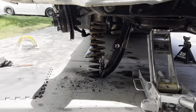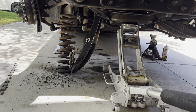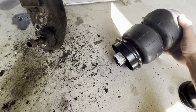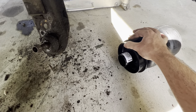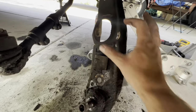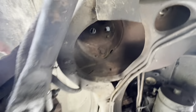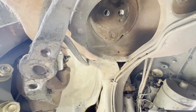The jack kind of got stuck — I wasn't high enough in the air — so I just did it this way to get the jack out, and then the spring literally just falls right out. Let it back down on the jack stands and we'll continue. We've got the bag with sealant on the fitting, the lower back bracket — there's no adjustment really on this one, just bolt it in loosely with Loctite on the bolt. This fits down in the pocket which is slotted for some adjustment.